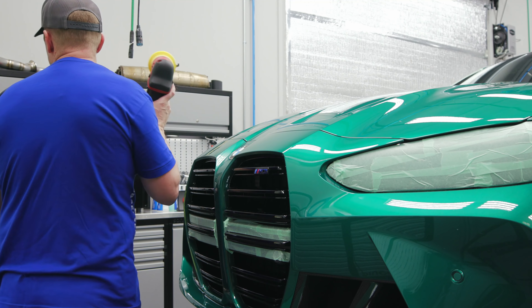We could try a little rotary one-inch with an extension. The three-inch is not gonna really get too far in there. Let's try the rotary with a little extension. I usually only like to use rotary when I'm up next to an edge somewhere so the DA isn't butting up against it, but I think the rotary might work okay on this here.